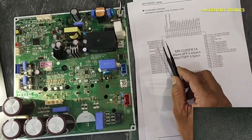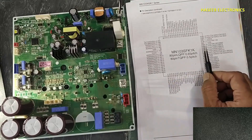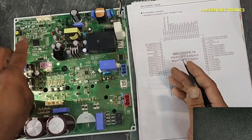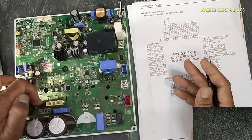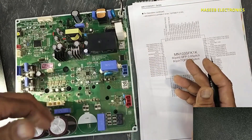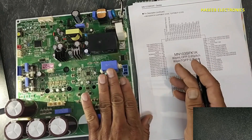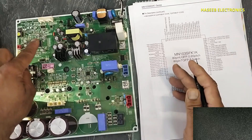While testing signals, we can only check analog signals — like voltage values. We cannot determine the exact voltage value at digital pins because those output signals are changing all the time. For analog inputs, if it reads 1 volt, that is normal; if it reads 4 volts, that means overcurrent. In the IPM section, if the current-sensing voltage is 0.5V that is normal; if it is 5V, something is wrong — maybe the IC is bad, maybe the IPM is bad, or maybe a command signal is bad. While troubleshooting, we need to trace the exact line specified for that fault.